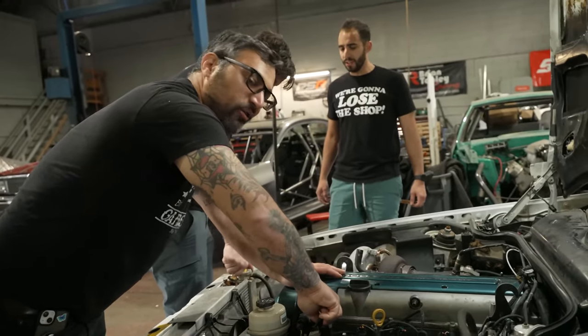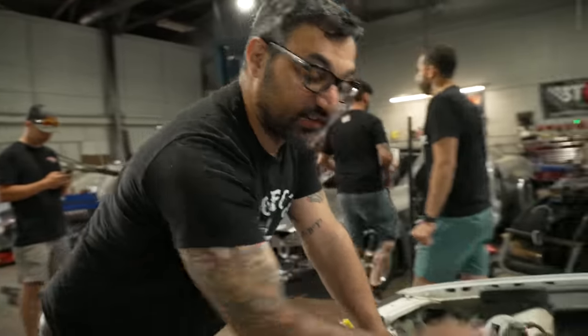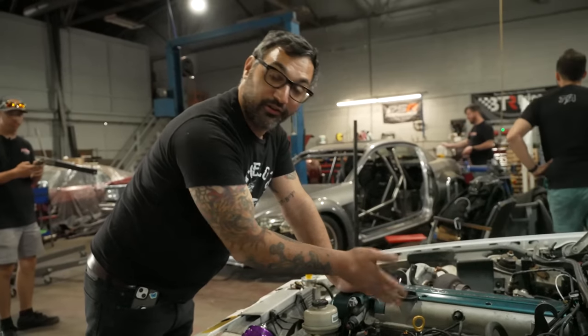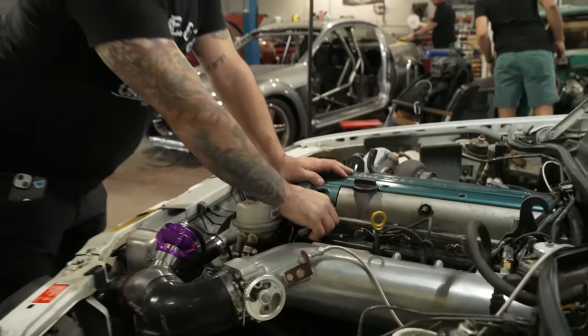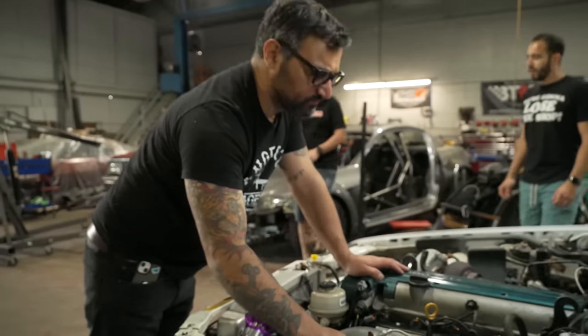Yep, they're all working. These two injectors were not firing previously, so when I take the connectors off and the engine drops down in RPM and sounds rough, we know they're working. When I reconnect them, it sounds happy again. You hear it, dude.